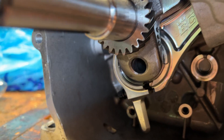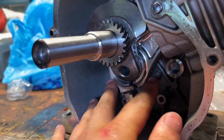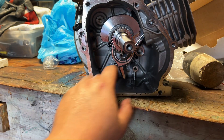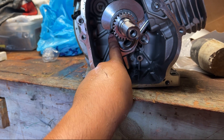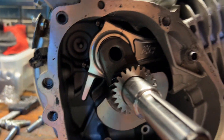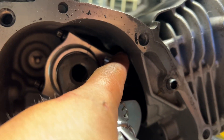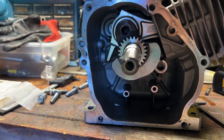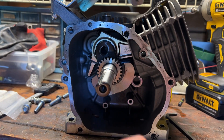We're going to drive the piston and rod down and connect it to the crankshaft. We had minor technical difficulty but got the rod in with the crank. We finally got the rod installed - the initial torque is 60 inch-pounds on each bolt, then alternate at 15 inch-pounds until you hit 150. I had to stop the video - had to clearance the top of the block because the top of the rod was hitting where the jug meets the cylinder. I checked the rest of the block for clearance issues, put the cam in to check if the crank was hitting the compression release - it's not. So I'm going to torque this rod down and finish assembling the block.